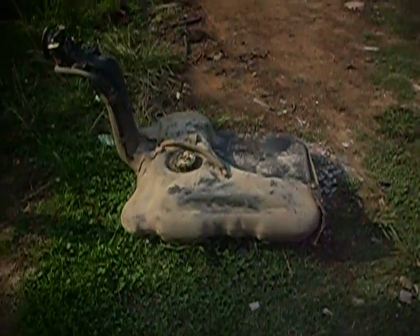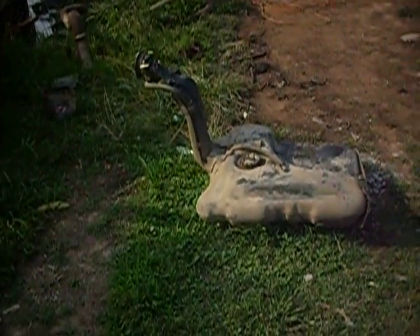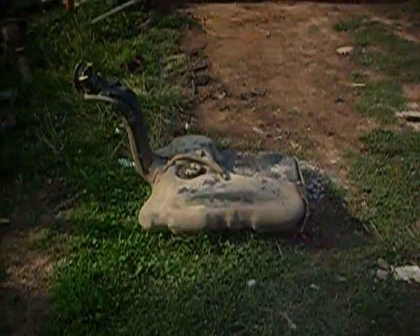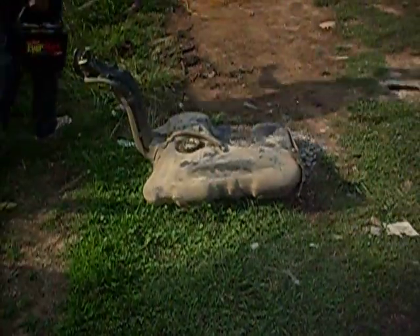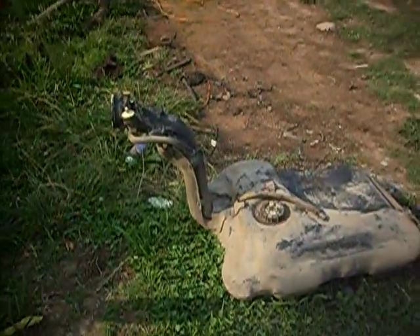Another modification was the fuel tank. This is the original fuel tank out of the Jetta — which, by the way, as of right now this is for sale. It's a good fuel tank. We're running the car on the original Fox gas tank. The only modification I'm aware of that we had to make was the filler neck — the little flapper thing in the filler neck had to be opened up to accommodate a diesel pump to fill it. But other than that, we're running the Volkswagen Fox fuel tank and the Volkswagen Fox fuel pump, originally designed to pump gas, now pumping diesel. We couldn't put the Jetta tank in the Fox because of configuration issues — it's a rather unusually shaped tank with a strange neck sticking up. So we're just using the Fox fuel tank to run diesel in it.